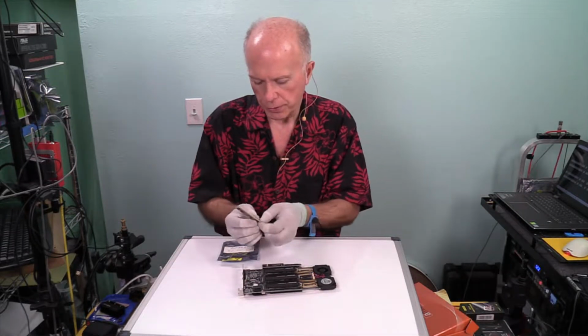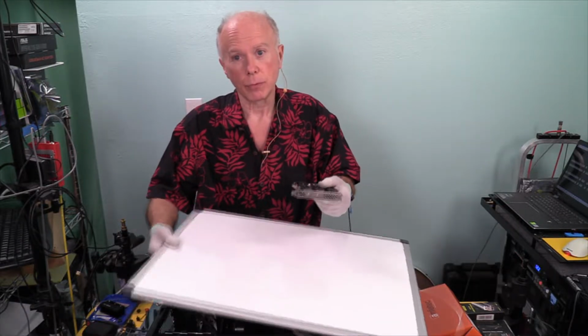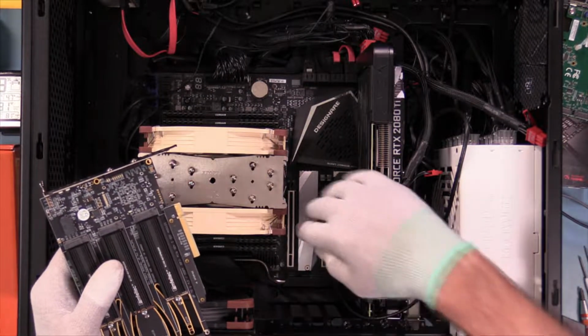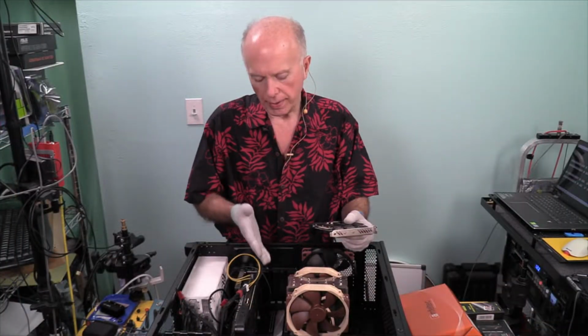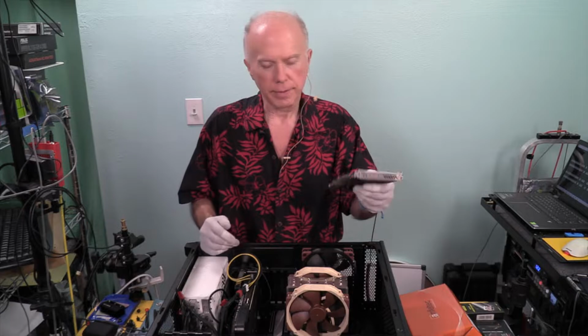First thing I'm going to do is be sure and secure this edge connector. Okay. Looks kind of funny like that. In an 8-lane slot, we're going to retest. Now this is the test, and I think the location is going to be a lot more relevant to a lot more users that don't have a dedicated 16-lane slot. Because think about it, if you've got a dedicated resource like a 16-lane slot allocated and you bifurcate it, you got access to 4 drives, this makes no sense.